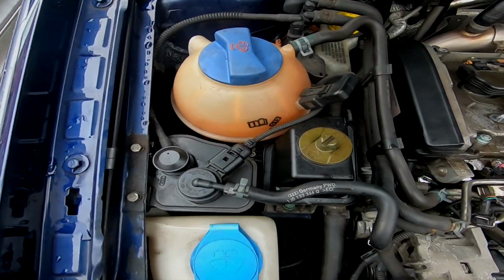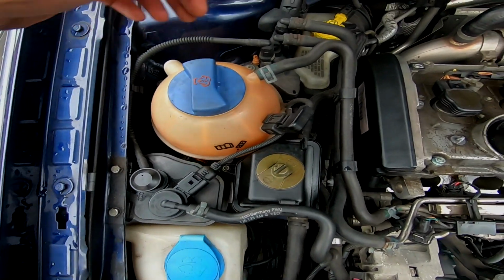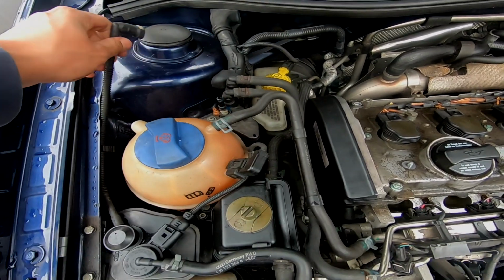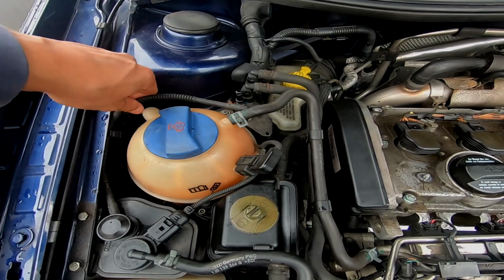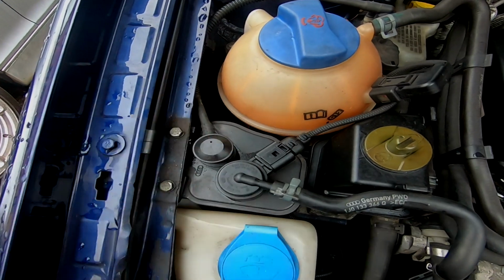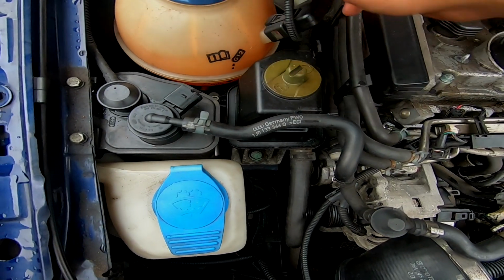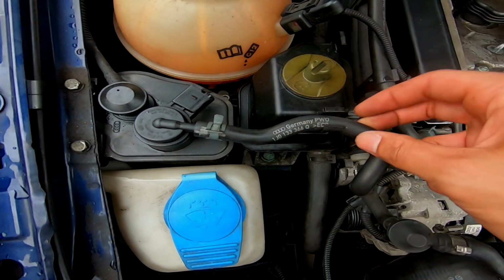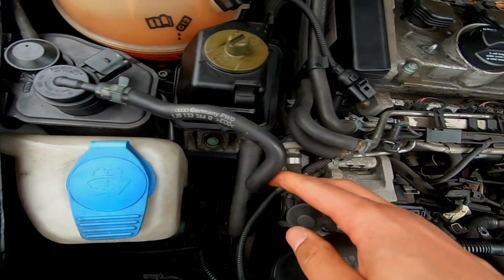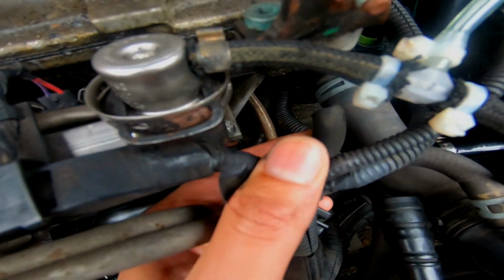Okay, so I'm now going to turn my attention to over this side of the engine bay. What I'm going to do is disconnect this line coming off here. That will be getting plugged, and this comes all the way down here. I'll be unplugging that off the Evap reg, and I will be disconnecting this from the Evap reg, which follows the line of all of this vacuum down to one of the hoses that we cut earlier.